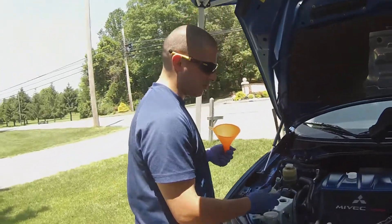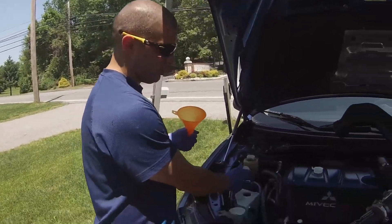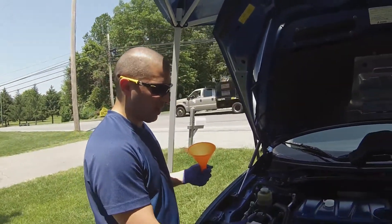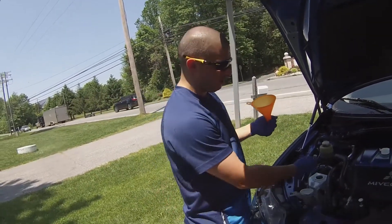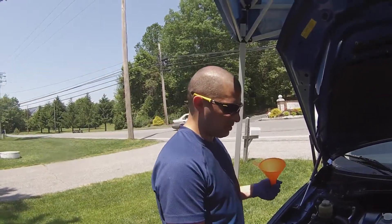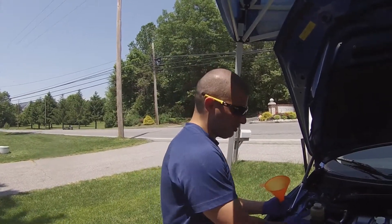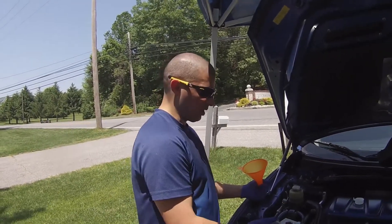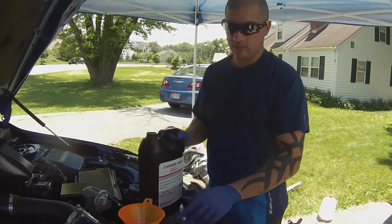When you install an aftermarket tank, there are a lot of tanks out there that should come with breathers but some don't. You need to make sure you have a breather attached to it. The purpose is: if it overflows or the pressure fills up the tank, fluid has somewhere to go. We've routed this to the bottom of the car right underneath the under panel with this hose, so if the system becomes over-pressurized and fluid needs to back-flow it has somewhere to go. The factory one that comes with the car has a breather, but for aftermarket tanks you need one so coolant doesn't destroy your engine bay — it'll come out and down the bottom of the car instead.